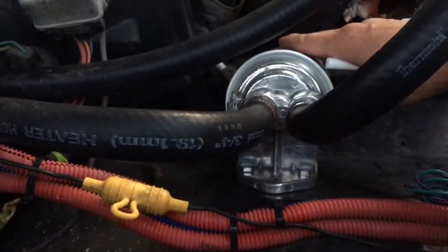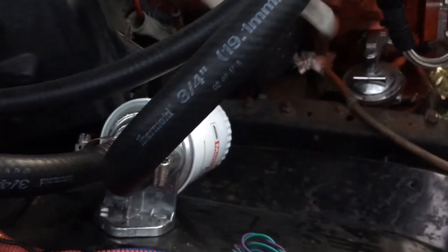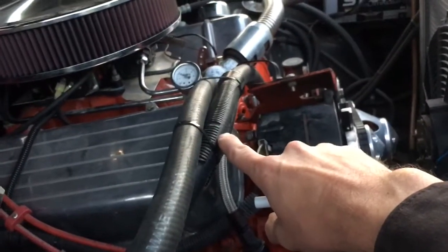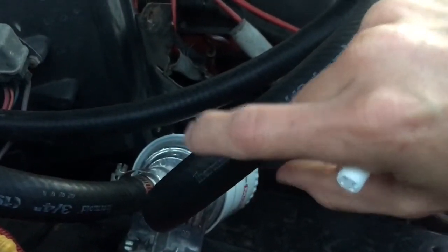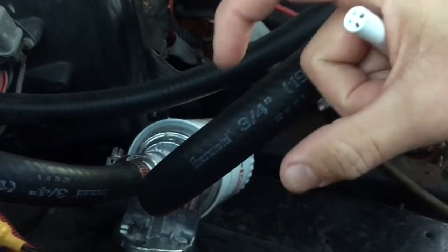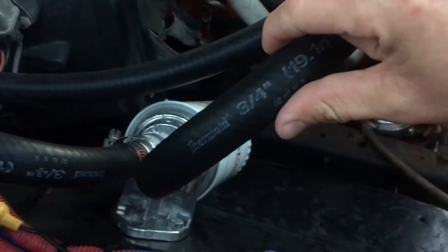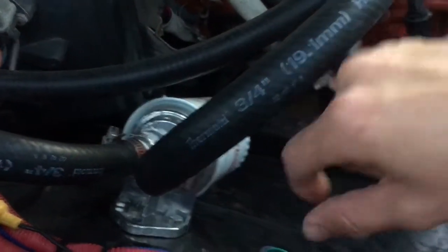What I was doing — if you know what an oil filter looks like — that center big hole is your return, and the outer perimeter holes are your feed line coming to the filter. So thinking that this front line from the water pump was a feed line, I was forcing water through the center port of the filter and trying to get coolant out of the perimeter holes. Good filters have a diaphragm, which is basically a one-way check valve, and it won't let the water or oil go the opposite direction. That's why I wasn't getting any coolant into my heater core and why it was running so cold — and why this filter never warmed up.